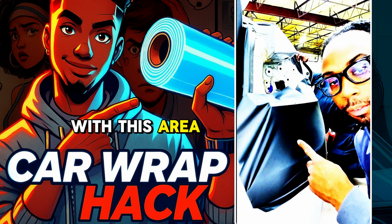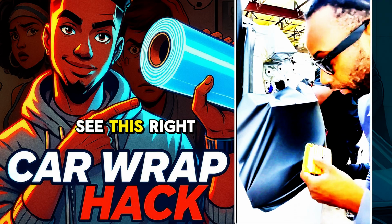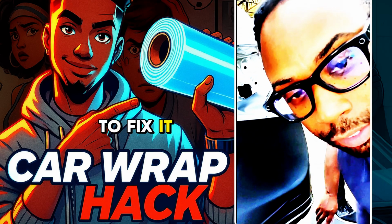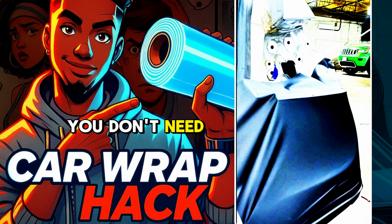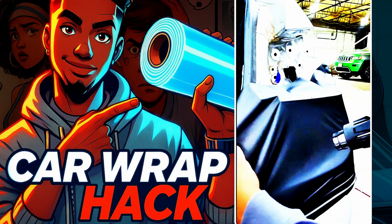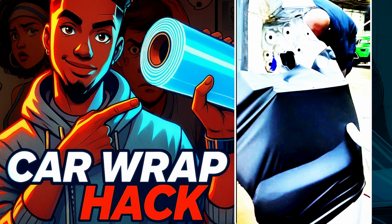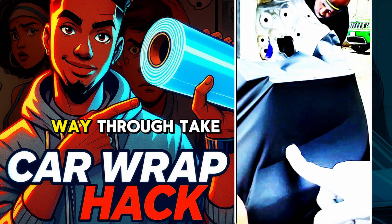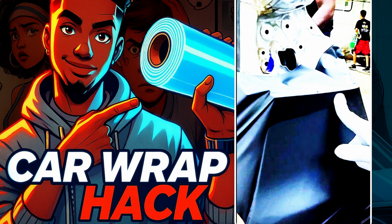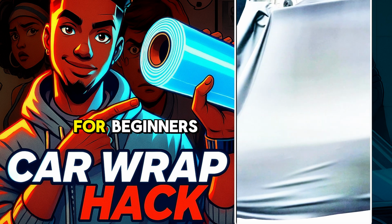When you're dealing with this area right here, stop trying to squeegee up. Every time you see this right here, you're gonna crease it. You squeegee up, you're gonna crease it. Let me show you how to fix it. As we're working on this area, you don't need a squeegee in this. Now we're gonna warm up the vinyl. Start at the bottom, and with one finger, just push it all the way through. Take your time. No glue lines, no creases. This is great for beginners.